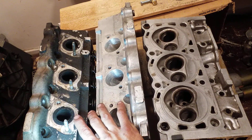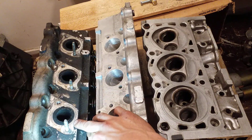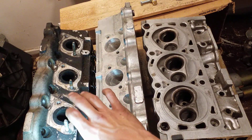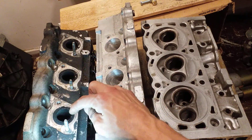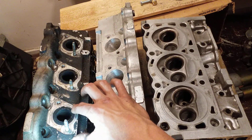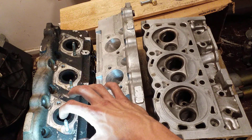The reason why is the exhaust manifold gasket goes all the way out to this ring around the edge. So you actually see almost like an X-ray 3D vision of where the exhaust manifold gaskets are on these right here. What's cool is when you pull it off, that ring is stamped on there. So when you're porting them, you're actually able to use that as a 100% contact point, and it's super simple to do.